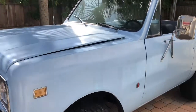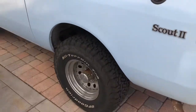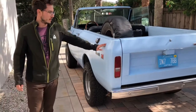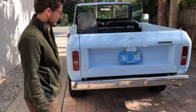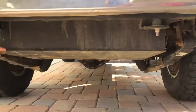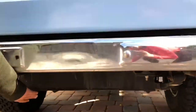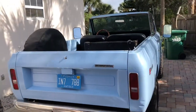So Danny, what did you do for work on this? She has 33-inch tires with a 2-inch lift, so I've replaced all the leaf springs and things like that. Ended up rolling on a truck bed liner without any texture on the outside. And then you can see down here, this hanging a little bit — I ended up installing a 30-gallon tank with a 1/8-inch steel plate on the bottom, so this thing's basically bulletproof on the bottom.